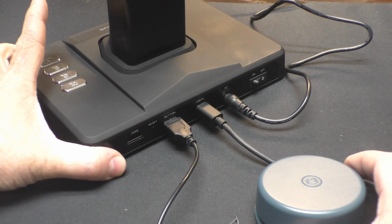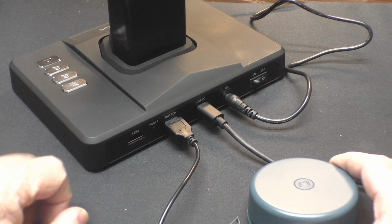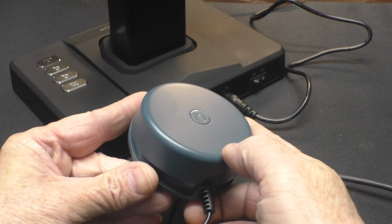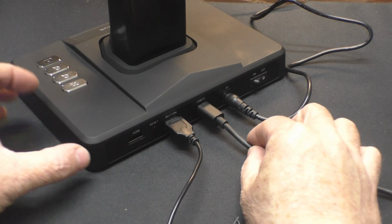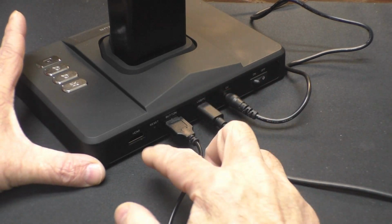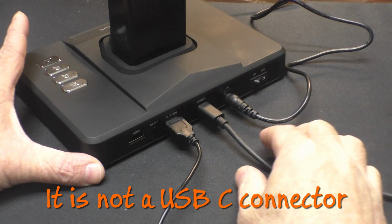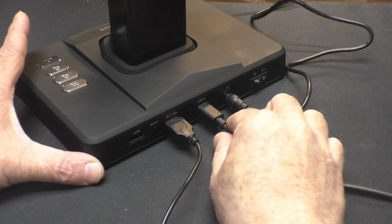I wanted to do a quick tour around the CZUR document camera here, since this is a device many people won't be familiar with. Starting on the back panel here, we have an HDMI out. We have a button input, which is for a hand switch they include, or my favorite here, the foot pedal that they include. You just step on this to have it take the picture. Then the USB output to your computer, the power in, and a power switch. Now, when you're using the HDMI output, you can't use the USB-C and vice versa. This is designed if you just want to use this as a presentation camera. You can also use it as a presentation camera through the USB. We'll see that in the software in a bit.